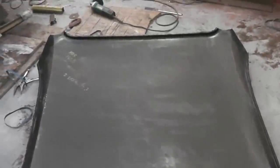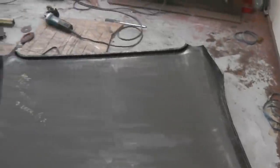Before your eyes is the roof skin, flipped upside down, the Portuguese roof skin, quite easily unpicked from the remains of its roof structure, basically fell off. They just migged the edges of the skin on. So all I did, I just sliced the edges and ground a little bit, and the skin was pretty easy to remove. The inner rails of the roof, they were rotted out. I might show you them later, but it was a mess, and the car's been that smacked. Every panel and structure was dented or rusty.